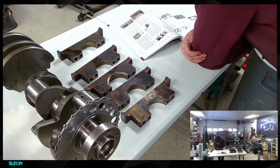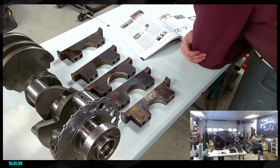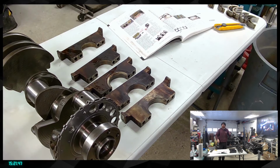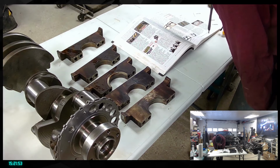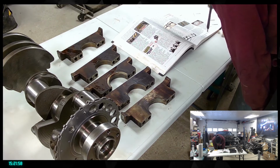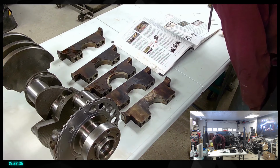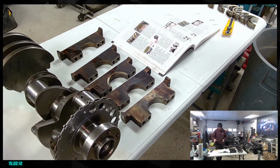Fasteners. Okay, some great news for any rebuild is that many of the factory fasteners can be reused, as there's a good chance they will be in decent condition. This is because GM used very high quality bolts throughout, and that's a fact. Whether you're talking about engine cover bolts or main cap bolts, chances are you will find minimal corrosion and can reuse these fasteners provided there are no issues. A notable exception to the reusability rule is the LS head bolts. Okay, yes. So basically, I'm right.